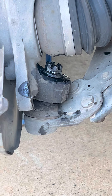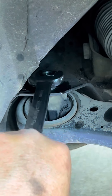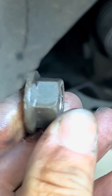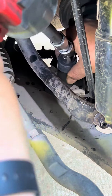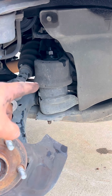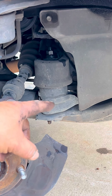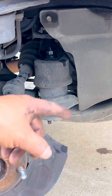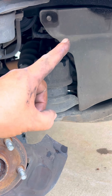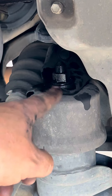So now we take the rear bolt — the 22 millimeter. Now we go back there and take out the 19 millimeter. Now that we have taken off the rear 22 millimeter bolt, we have one more right underneath the motor mount on the passenger side, and we have to loosen and take off all the nuts that hold this motor mount — there's the motor and the chassis. Before we lift the motor, we have to go to the front and loosen the front motor mount as well. We start by removing the 19 millimeter nut of the passenger side motor mount on the top.